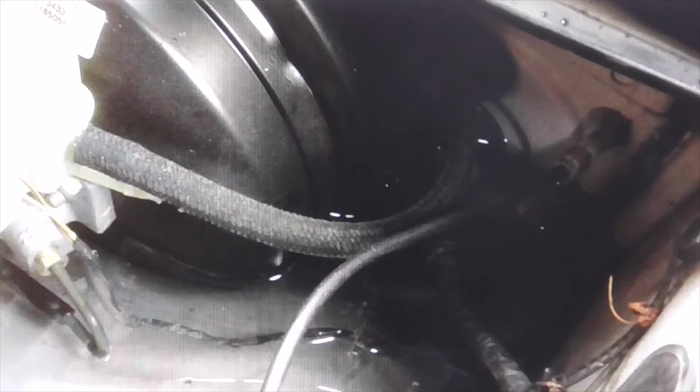Then, to all of you who have BMW E39, E46, E38, some of you will have already seen it. It will have happened to you. I know many people who have already had it happen, but this warning is for those that have not yet had it happen. You have recently acquired them and you do not know about this problem, that you must clean the drain hole that is underneath so that the water comes out.